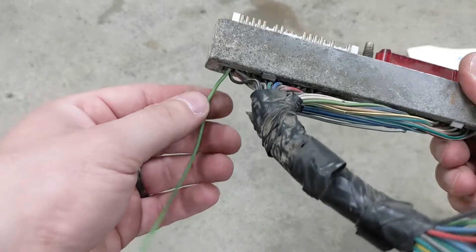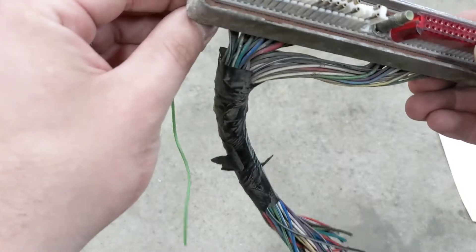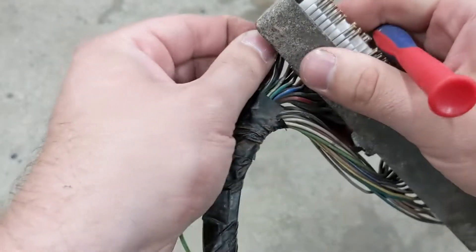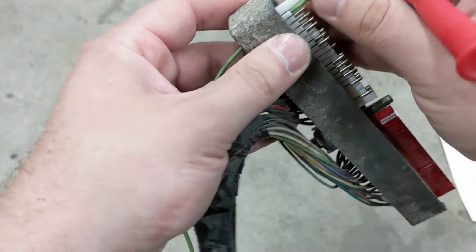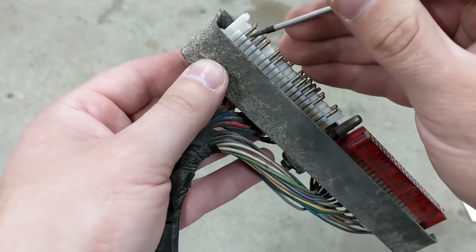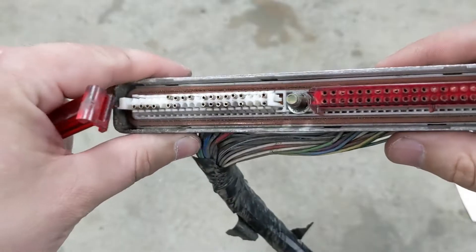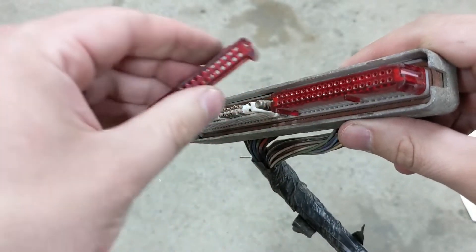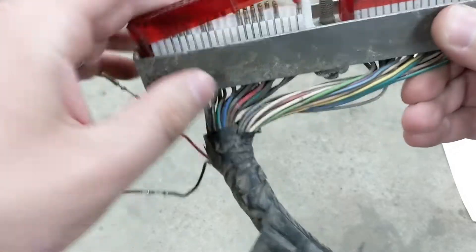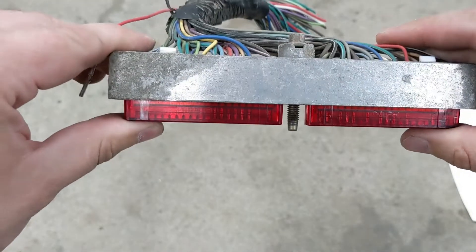This light green is the color of the reverse lockout solenoid ground, which is what we're going to add. Got to remember what the locking tab is that holds them in — we can pull it out forward, that's an easy way. But if you're going to reuse one, you probably wouldn't want to do that. Pull the tab up a little bit and then pull the wire up a little. To put these back together, look at the orientation — you want those little fangs down. Stick her on there, clicks in place, and it's good to go.